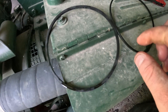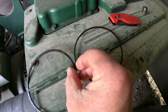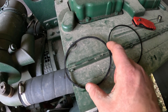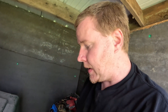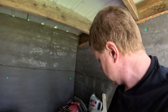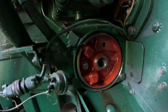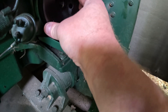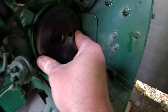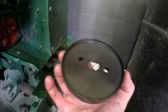If it won't fit, I'll use the o-ring that comes with the factory filter and work that back into the groove, then lock down the filter adapter and see how that works. Here's the issue — the o-ring that came with the Timco adapter is just a little too thick. It is the right diameter, but there's a noticeable thickness difference and it doesn't quite fit down in the groove. I could probably force it, but I'm not going to risk it. I pulled the factory o-ring out of the sealed filter set, coated it with oil, and it slid right into place no problem. Looks like the adapter should fit in here — we'll give it a shot.